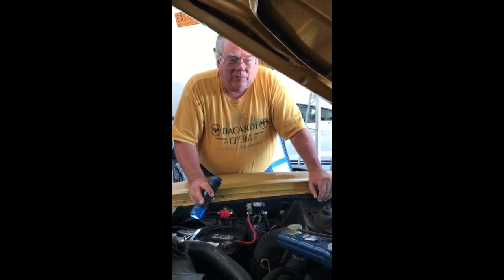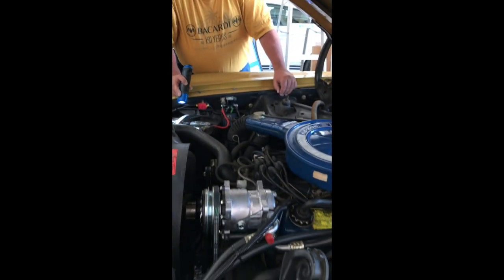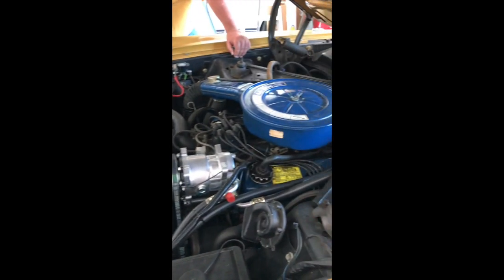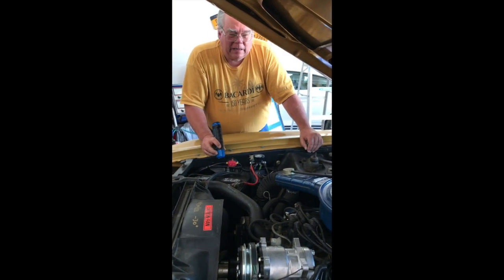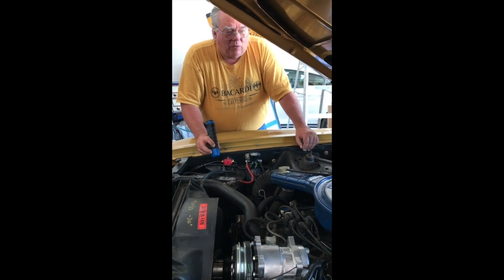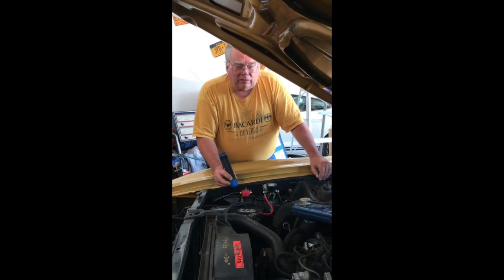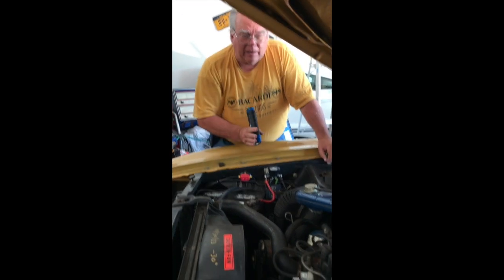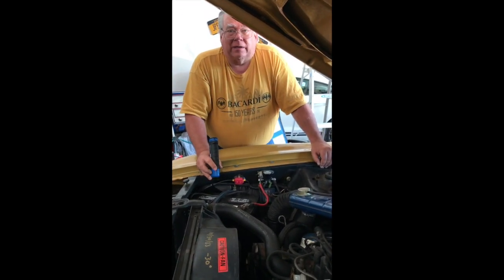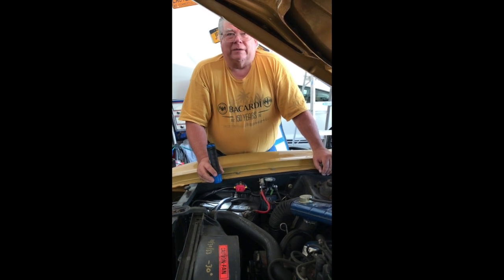Hi, Gil Hale with Linda Hale as the videographer. I have not yet done one of these video postings to the website with repairs or upgrades to any of our pony cars — this is a first. We are looking at working on a 1973 Mustang convertible. The other day I noticed a coolant leak coming from underneath, from an area just below the water pump, in a splash-type pattern. It tells me the front seal is leaking. Good enough for me to go replace the water pump — 47 years old, it's time.